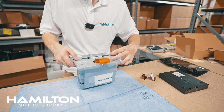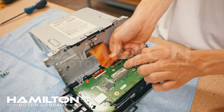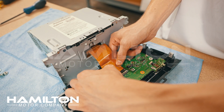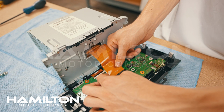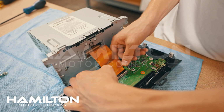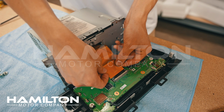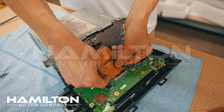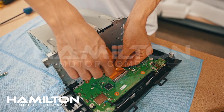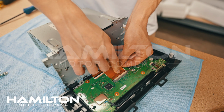Put the screws back in here. We're now going to take this other ribbon cable, again black pointing towards the sky, the gold side down. We have tabs on either side here. We'll take this other ribbon cable. Once again, we have the black going towards the sky, the gold towards the circuit board, and we'll line up the tabs on either side. When you've got the tabs, sometimes it's a bit of an angle. You have to go in on one side and then the other, and what we want to see is this to be fully flush. Black line parallel to the socket, fold it down.